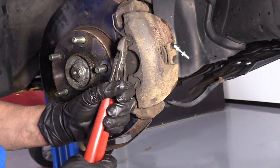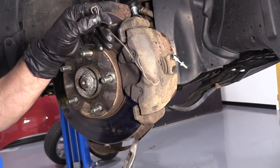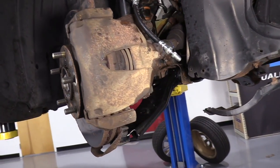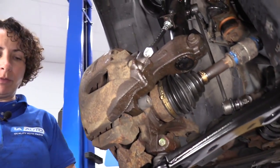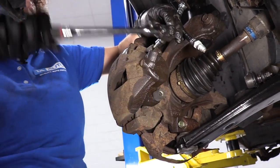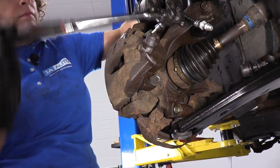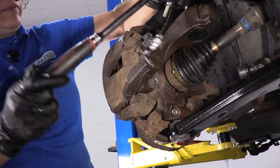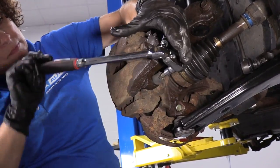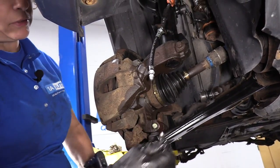It's a spring, and it goes in these little ear holes. Oh, just the other side, because it's the spring, they just slide in. I'm going to show you how to reinstall the new one when we get to that point. So with that out of the way, now I can take the slider bolts out. These are Allen heads, 7 millimeter Allen heads, and they're mounted in the back. You have a top and a bottom. To the bottom one. Take that slider right out of there, show you what it looks like.